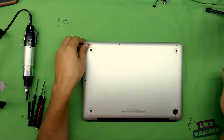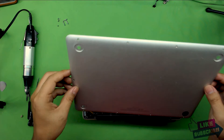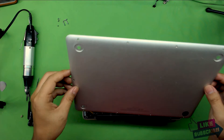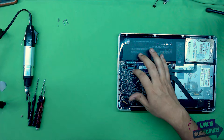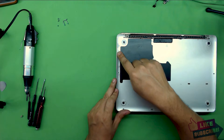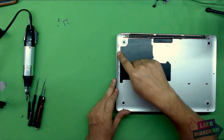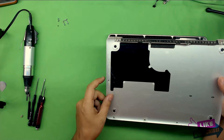Sometimes if your MacBook is not turning on before replacing the power jack, you might want to take the bottom cover out, unscrew it and clean the back cover. The MacBook won't actually turn back on if there are some connectors on the board that aren't making good contact — there are nine pins right here on this end. If these nine pins don't connect to each other properly when the bottom cover hits them, your laptop won't turn on. You might want to grab some rubbing alcohol and start cleaning all these pads.